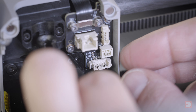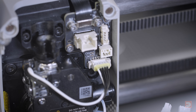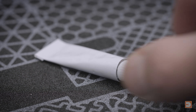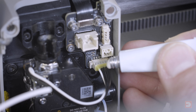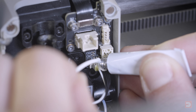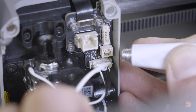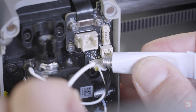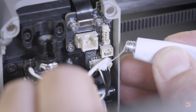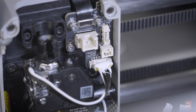Plug in the filament sensor cable and once you're confident it's in place, use a little bit of silicone glue to hold it in there. It can be useful to have something to help you spread it, especially with the tube that comes with it as it doesn't have a fine tip nozzle — a short offcut of filament works great. You don't need to go too heavy on the glue; just make sure there's enough covering both the plug and the port, and try to avoid getting it on the main circuit board or other plugs.